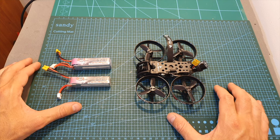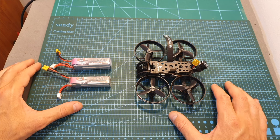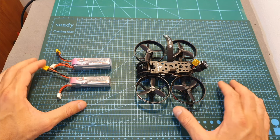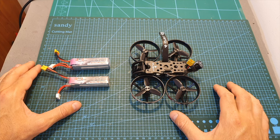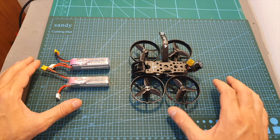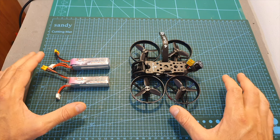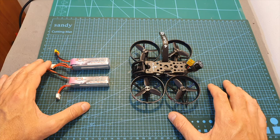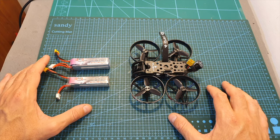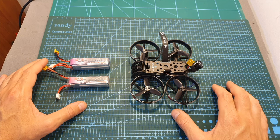The next thing I've done is to head outdoors and test the iFlight CineBee 4K using GNB 520 mAh 4S and 3S LHV batteries. In terms of flight time, you can expect about 4 minutes when not pushing the throttle, which is quite okay. And in terms of performance, the quadcopter performed better and could do some acrobatic maneuvers using the 4S battery. And anyway, you have to remember and keep in mind that the main purpose of this quadcopter is to take cinematic shots. And in my opinion, it excels in this purpose. As you're about to see, the flight footage is practically jello-free.